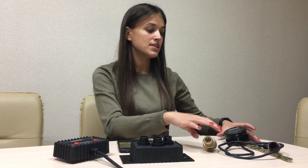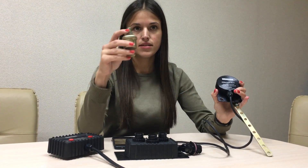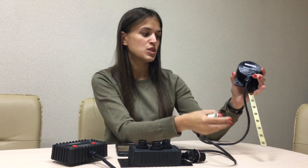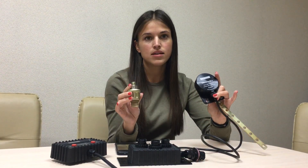Our on-board weighing system EUROSENSE DIFFERENCE consists of several parts. The first part is SENSORS. Pressure sensors are used for vehicles with air spring suspension, and displacement sensors are used for vehicles with leaf spring suspension. These sensors are analog.